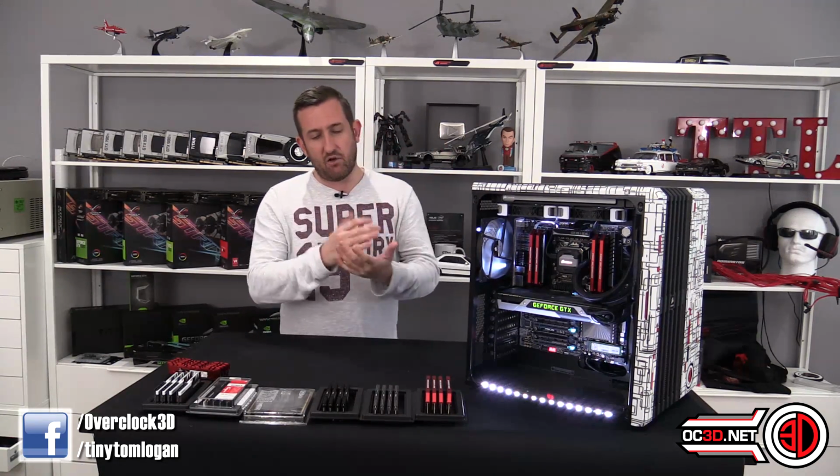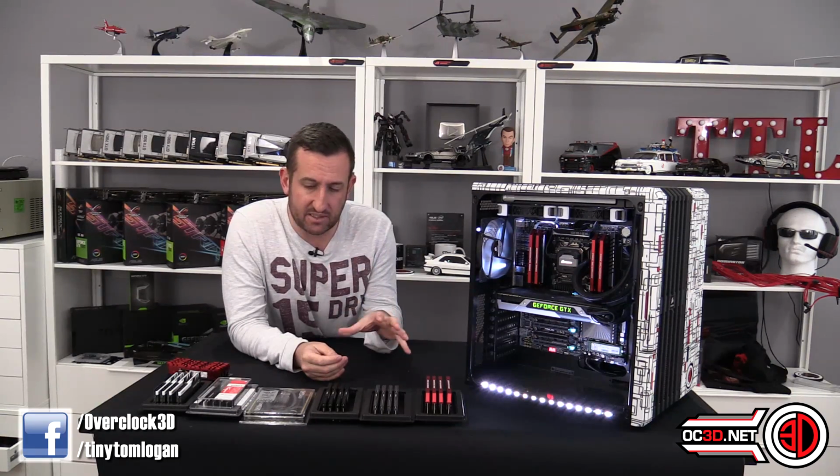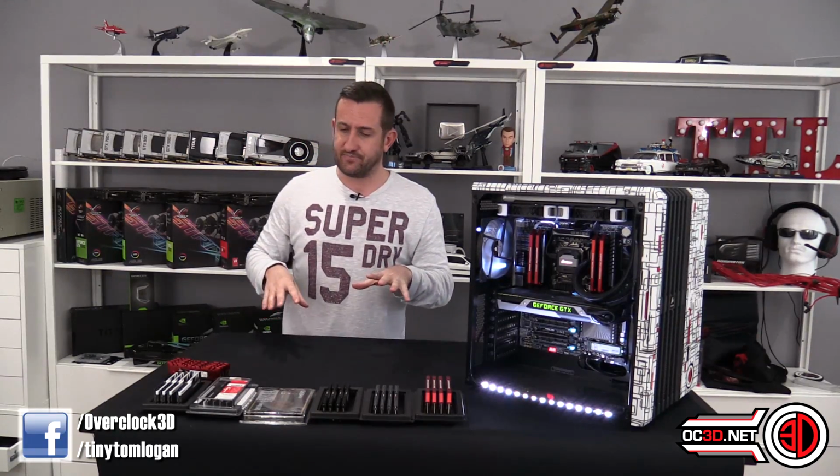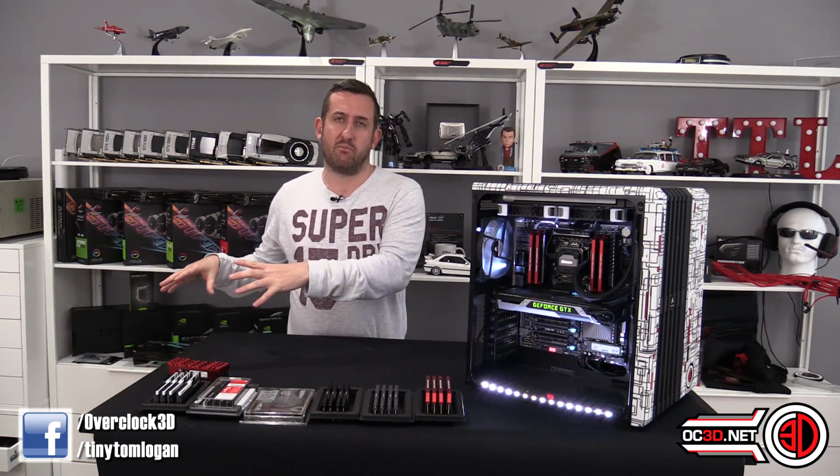I think if I'd spent a little bit more time tuning some of the memory voltages and stuff, and by that I mean the cache and the VCCIO, I reckon I could probably have got the scores up a little bit more, an outside possibility. But all of this was done trying to keep it to a sensible level, because I'm not a professional overclocker. I can't sit there and go through timings and stuff, because at the end of the day I don't expect you guys to do that either. So I try and keep the balance between knowing the things to play with and not wanting to spend too much time, because that would be unrealistic to expect you guys, or the wider population, to do as well.